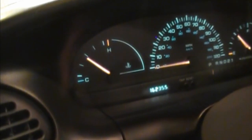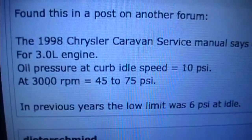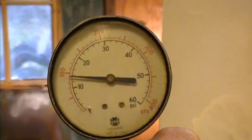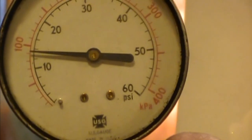The car is now warmed up. I haven't gotten the oil light to come on yet. I looked it up online: at curb idle the pressure should be about 10 psi, and at 3,000 rpm it should be 45 to 75 psi. Right now I'm running 15 pounds at idle. Dropping it in gear, the pressure is reading about 13 pounds — that looks good. The oil pump appears to be working fine.